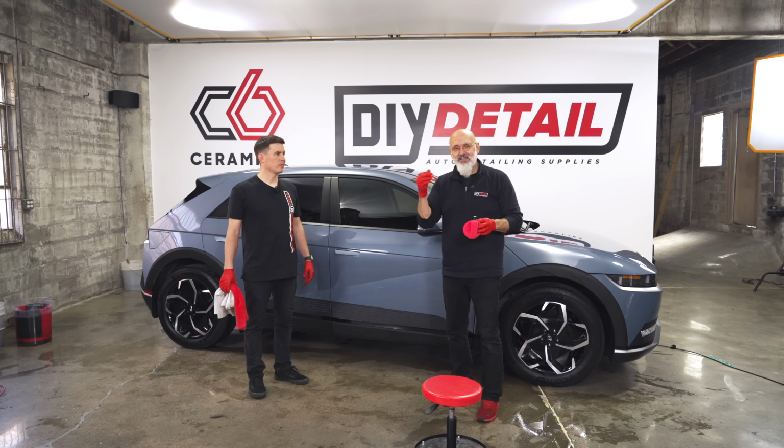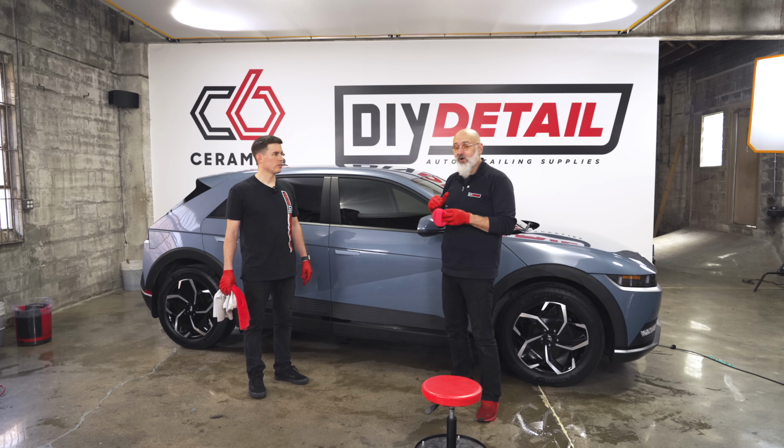Because we're not layering, we're not putting one coating on top of the other, we're putting one coating into the other. And the 8-year coating, we have to give it the time to bond, to coalesce, to cross-link into the paint and to itself, but the top layer of it is still a little soft, a little fragile. And when we put the 3-year on it, it goes into it. They're cross-linking together. We're making a new entity, and it's spectacular.